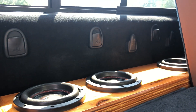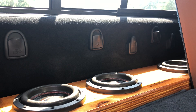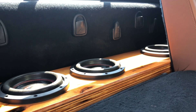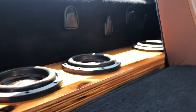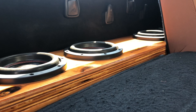I run it off a Rockford Fosgate 1500 BDCP. The last video I had with these four playing, I had it at 2 ohms. Because it's dual voice coil and I wired them forward, the lowest I can go is 2 ohms. So at the impedance rise, they might be getting around 1,000 watts — so that's 250 watts each.